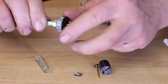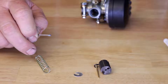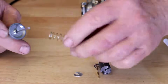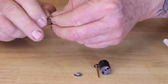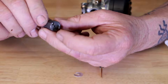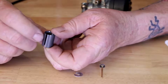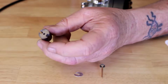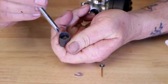I typically will screw this in all the way, get it in tight. Take the spring and push the spring in here. You have your carburetor slide here with the slot cut into it — that is where your cable will go.